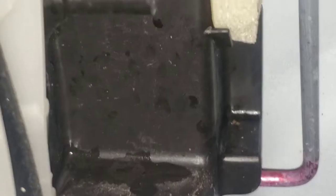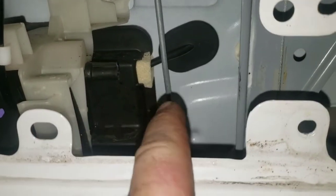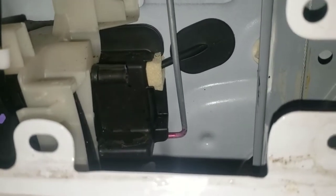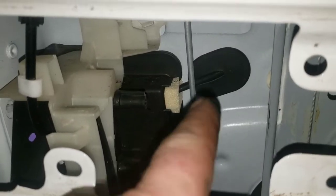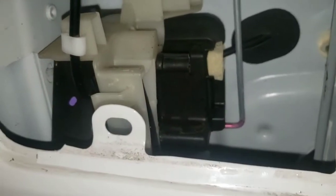You can see there's water buildup — water gets all over that. The older models did not have that black casing and did not have that updated door lock rod. So if you've got an older model F-250 — I want to say 2017 and before — those shields and rods have to be updated if you haven't had it done already.